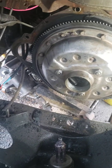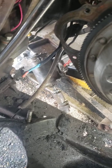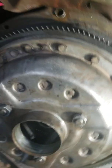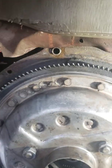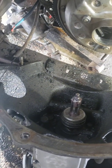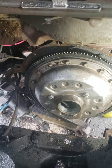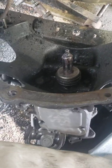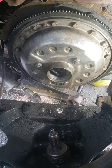I thought I'd go over real quick what I did to get this out. I basically just dropped the starter — it's still hanging down there by the wires, which is the right thing to do. I have a jack under the engine over there, so the engine is sitting up a little higher than normal. Someone must have bent the firewall at some point — probably me when I put this engine in, because this engine comes from a different car. This transmission isn't terribly heavy as far as transmissions go — definitely not as heavy as the one in my '51, which is probably 15 to 20 pounds heavier. So I'm going to move the driveshaft out of the way a little bit and try to muscle this thing on here, hopefully just line it up and bolt it in.